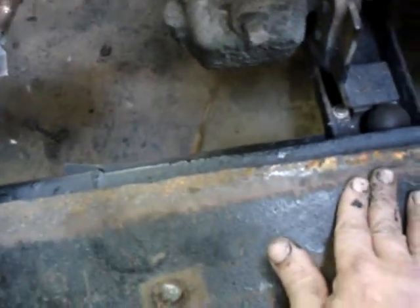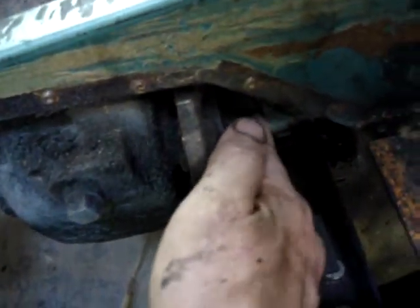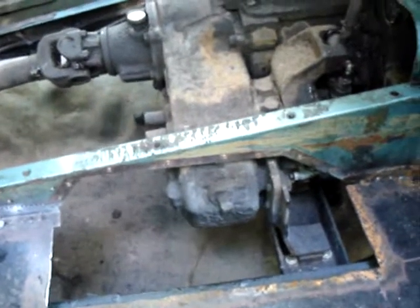One more thing I'm going to do, just to give it a little more ease of access — I've got a couple of these cheap hinges. I have the piece of metal that covers over here, and I'm going to take that piece of metal and hinge it. Those hinges are going to be back here, and up here will be a couple of sheet metal screws or pop rivets holding it. With that thing off, it makes it really easy to get to the U-joint on the front axle going to the front prop shaft — with it in the way, it is a royal pain.